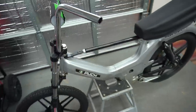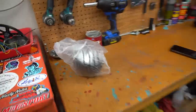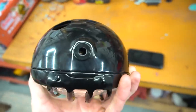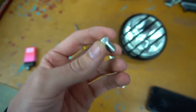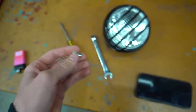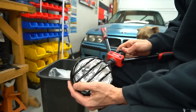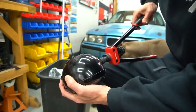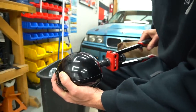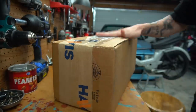Just for my own enjoyment I'm going to throw this headlight on — not going to wire it in yet — just to see what it looks like. The stock headlight had threads but this one doesn't, so I'm going to drill it out and install an M6 riv nut so I can thread an M6 bolt right into it. Used the riv nut tool, gave it a one-two action — riv nut is in, perfect.